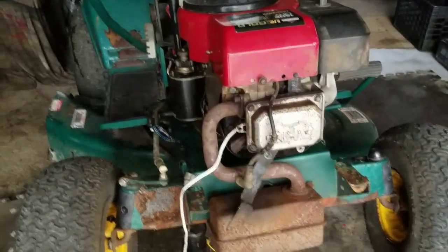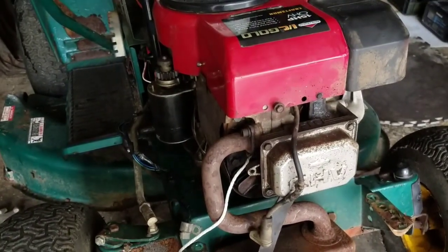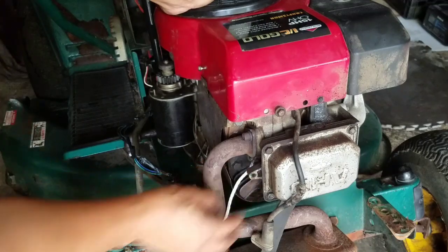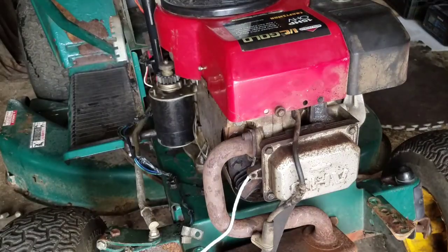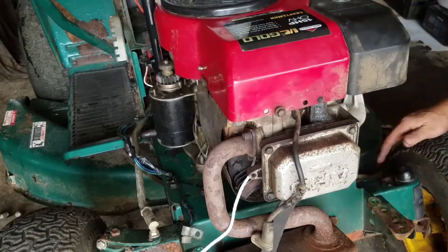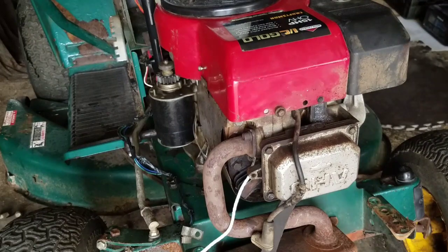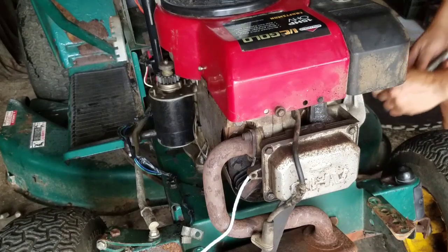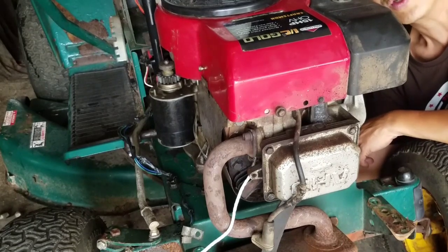If you don't want to use an impact to put on that bolt, and all you want to do is tighten it with a socket and ratchet, you don't want the flywheel to turn. So you take a rope, like a pull rope, and stuff it in there. So that as I'm tightening the bolt down there, the flywheel won't move along with it, because eventually the piston will touch the rope, and the rope will fill up the cylinder, and it won't go anywhere. So I'm just trying it right now.